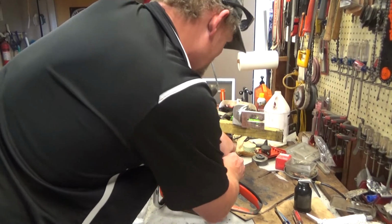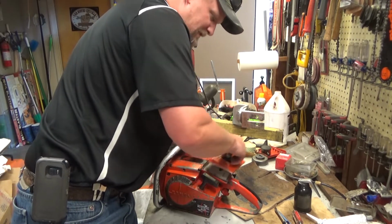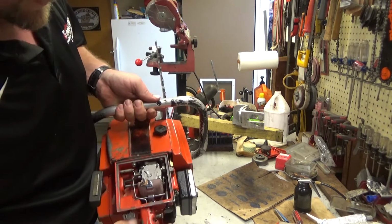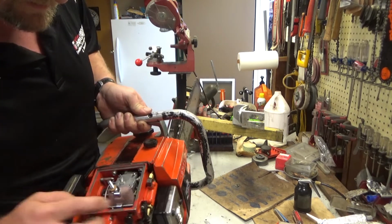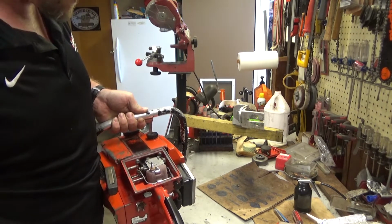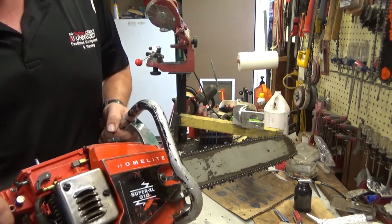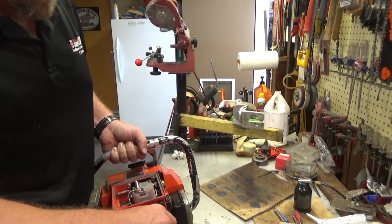This is an HS56A carburetor, and I verified in the manual that I've got for a 910 that that's what should be there. It's got the small choke rod, got the oiler that runs through the air box here. I need to get a handle grip down. I'm pretty sure I've got one rat holed away to finish this off. Just haven't dug it out yet. But it's got the painted muffler base, chrome cap. That is original, according to the part numbers I'm seeing.